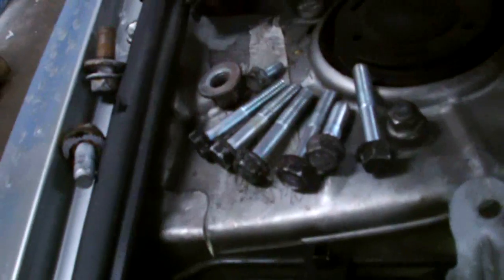You can take off all the studs around the pump — we have 7 studs in all. So there's one off there. Have a big tray underneath there to catch the antifreeze. And the next step now is to tap off the pump here — just tap it off and knock it off.